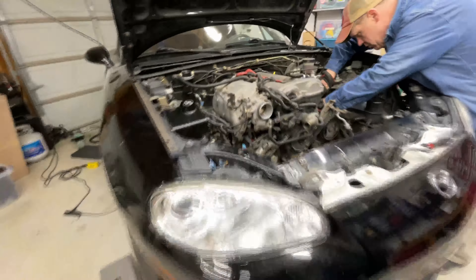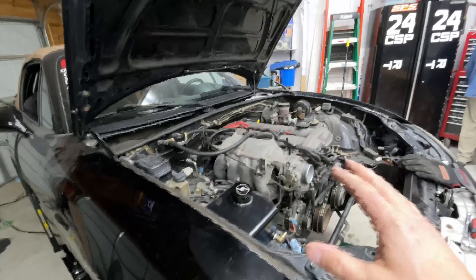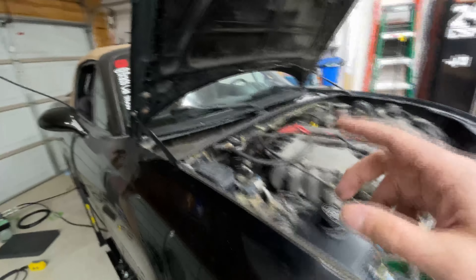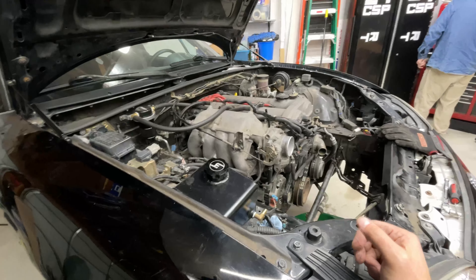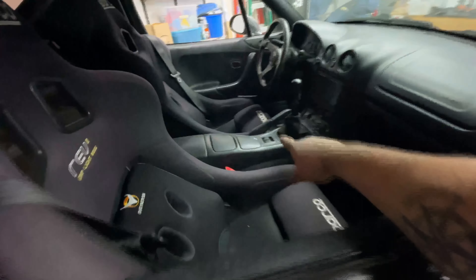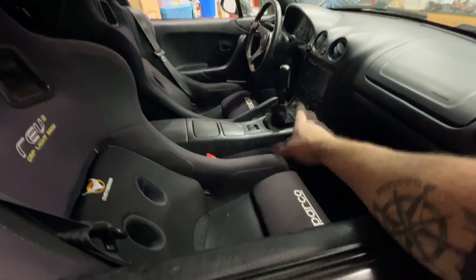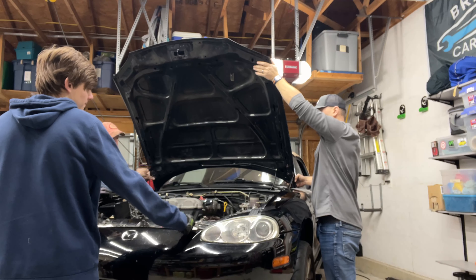Things are coming off — progress being made. We drained the power steering pump and pulled the pump. We're going to pull the hood real quick just to make sure it's out of the way — it's just four bolts. When you do that, you want to mark the hinges so when you put the hood back on you can line it back up the way it was. We got the driveshaft out and disconnected some of the PPF bolts from the transmission. The next step is to go inside the car, remove the center console, and remove the shifter — because the shifter sits right on top of the transmission and has to come off.